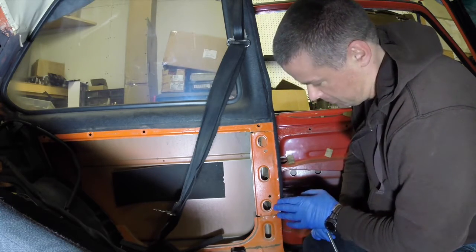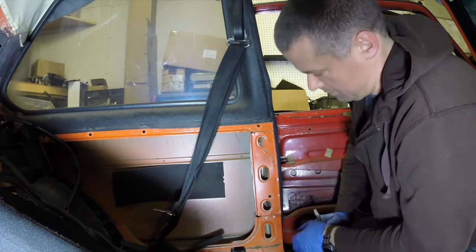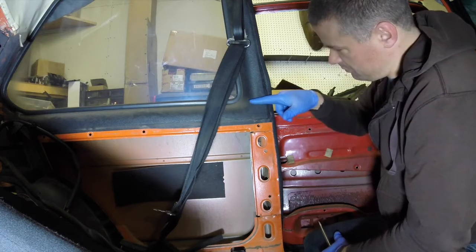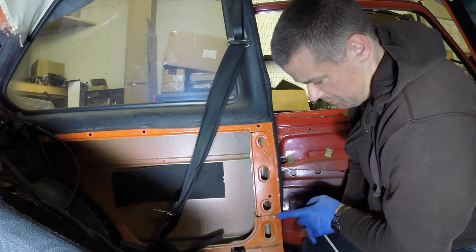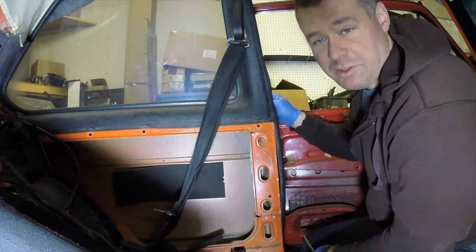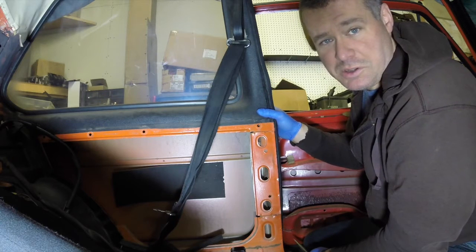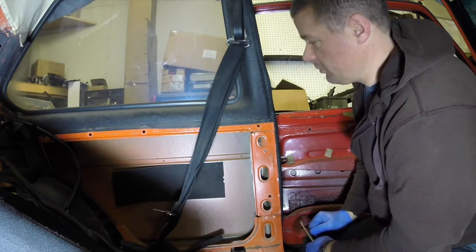This whole upper and lower assembly is tied together with this little piece of sheet metal here, and it's got just two spot welds, top and bottom. I really feel this contributes a lot to what's going on on the outside of the car - just outside here is where these cracks are forming. The simple solution is I'm going to grind these down and stitch across here to strengthen them up. We also have to do something on the outside to repair the crack - we can't let it go any further. We weld it, but there's a technique we can use to keep the cracks from growing. So let's get started.